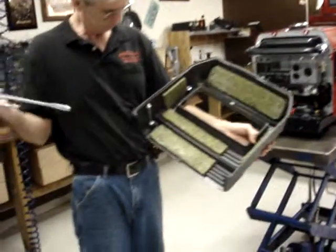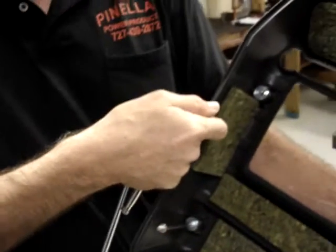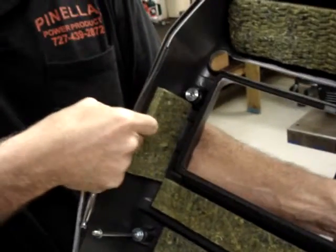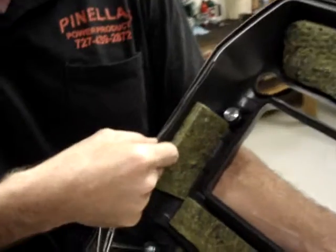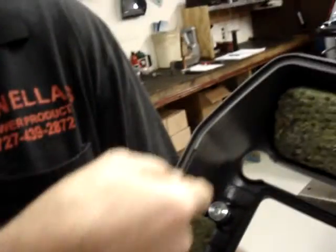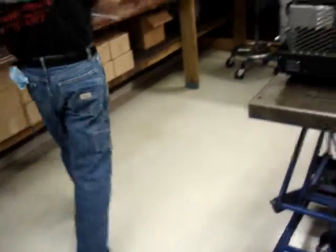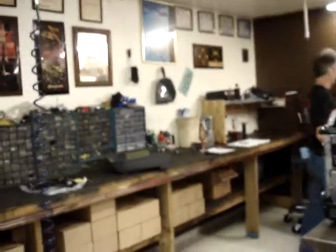When you pull the front cover off, make sure that the foam gasket stays in the groove. If it does not stay in the groove, simply push it back in. That's part of the sound deadening. And this is the stud that I spoke of that seems to be stuck to the nut. So we'll go ahead and pull that stud off of this nut.